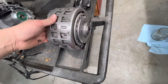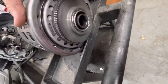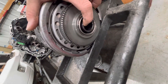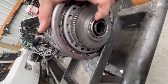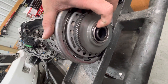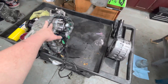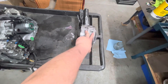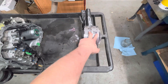Power will come in, the clutch will be applied, and then power will come out here. In a GT-R, the inner input shaft is going to be your first gear, third gear, fifth, and reverse. The outer one will be your second, fourth, and sixth. So you get the idea of how power comes in, and there's an A clutch and a B clutch — that's how your standard dual-clutch transmissions work.